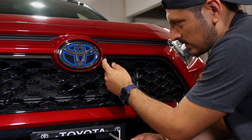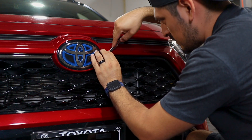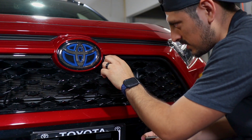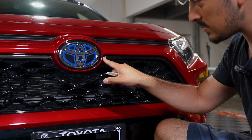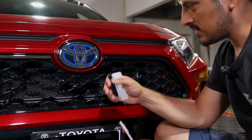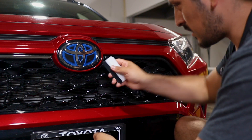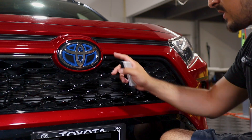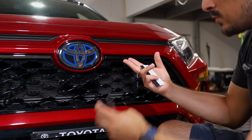If you don't want to tuck the film inside — for example on the top piece after doing the cutout — just trim off the extra material with a small slit and tuck it back inside. It should still cover all of the chrome. So that's one method. If you don't want to do this step, just trim off everything from the beginning edge; it covers up to the edge but won't cover the inside chrome. These are two different approaches. The same steps apply to the next panel since they're both identical.